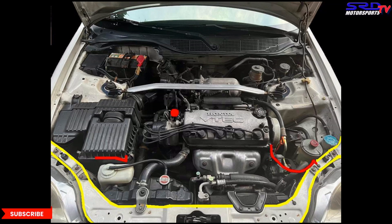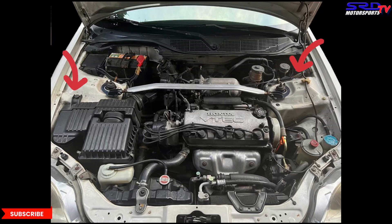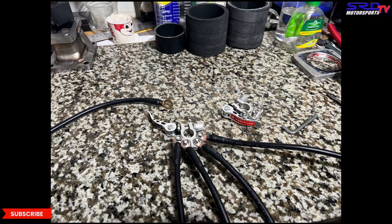Here's one for the locals: ever wonder why you suddenly need HID headlights because the factory H4 beams no longer seem bright enough? Actually, they might still be bright enough — it's just that the car isn't properly grounded, especially at the front end, especially after collisions or nose cut swaps. Different areas of the car may have different levels of ground, totally different from the battery negative, and that's not even counting the injectors running weird — probably why you're consuming a lot of gas.